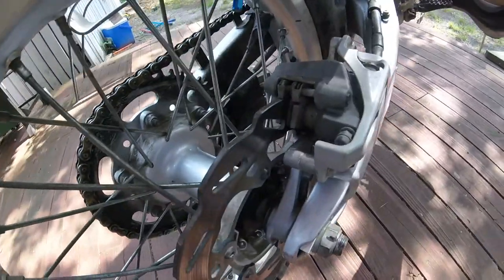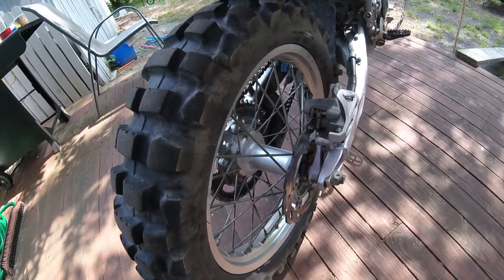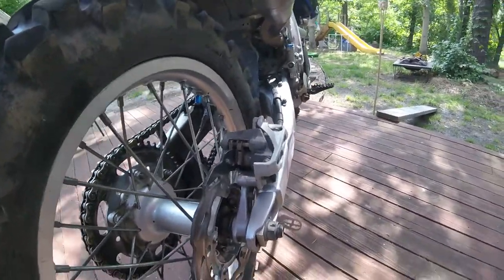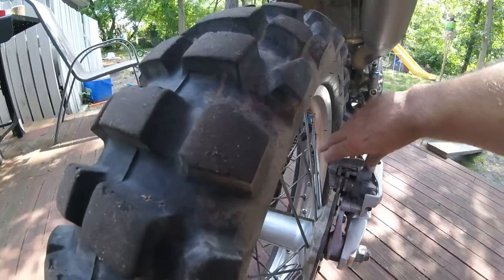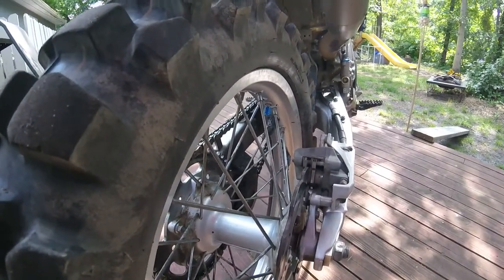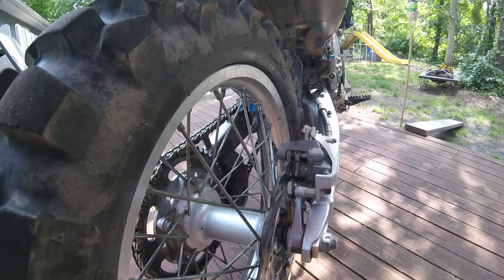You can see how far the piston is over, so what I'm gonna do is pull the caliper off and clean that piston up real nice and put everything back together. I'm also gonna put some waterproof Belray grease on this pin, because those pads should really wear evenly. It's a floating caliper - it should move back and forth as the brake engages. I'm hoping that piston's not out too far and I can just clean it up and push it back in, but we're gonna change out to a new set of pads.